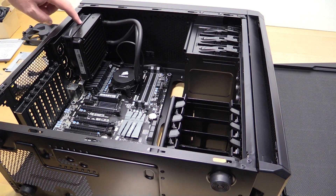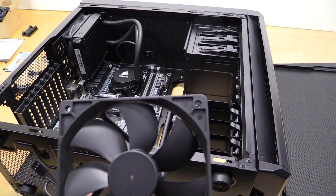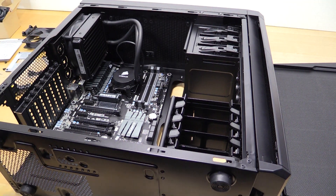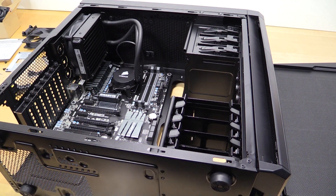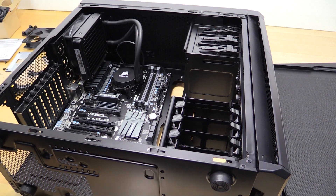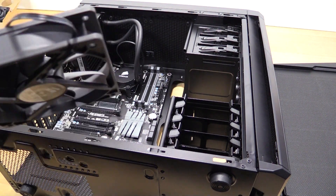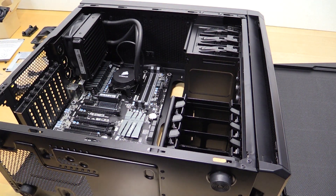Those are long screws, so you have to put the fan on the inside. I did replace the 120mm that came with the case because this is a more silent-optimized fan — even though they're almost exactly the same fan, the blades have no texture and it's a slicker, quieter fan. I could always put this in the front if I wanted to, but I'll give it to the person and they can decide — if the GPU doesn't get enough cooling they can stick it in, but I don't think that's going to be a problem.